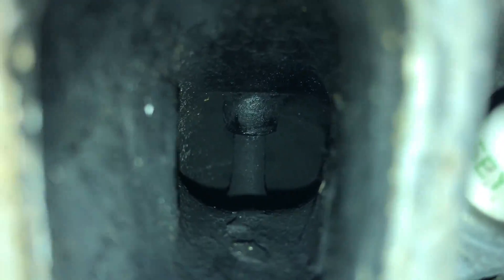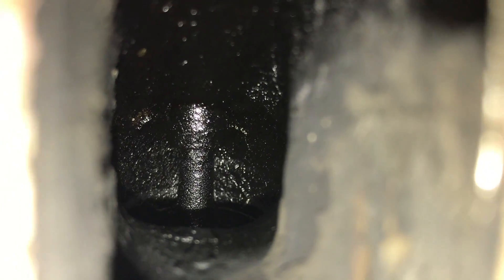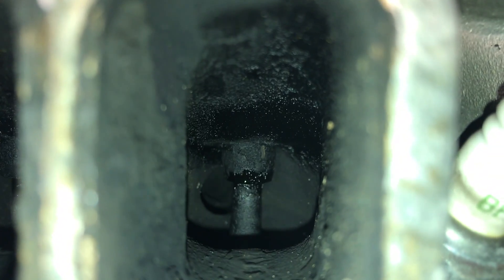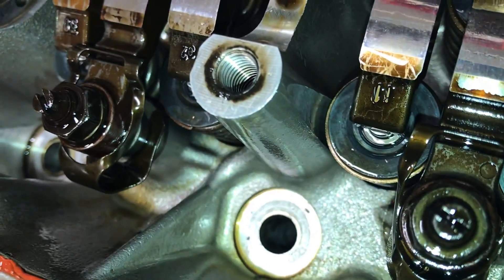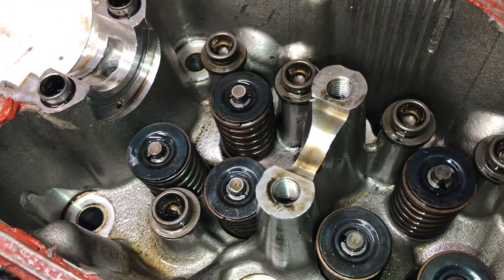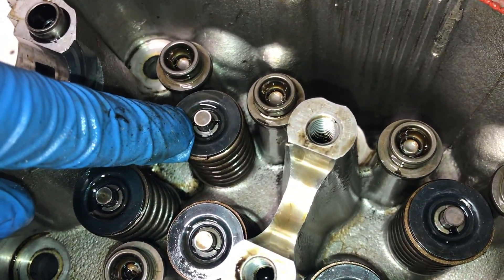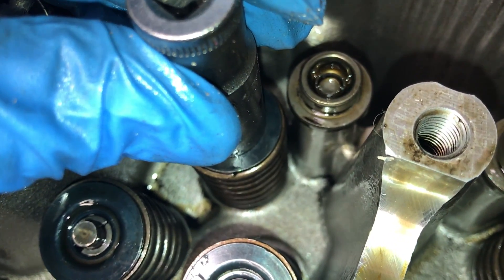Here is a quick look at the exhaust ports. You can see a tiny bit of oil residue on this one, but if you go next door there is a lot of oil residue on that valve and around that seal. Caps and camshaft removed. Now we just need to remove these rocker assemblies — to do that you just undo that clip which is seated on that pivot point, pull them out and they lift right off. Now we can remove these valve springs. A crude but effective way is to use a socket, place it on, then just tap it with a hammer and the keepers will pop out.